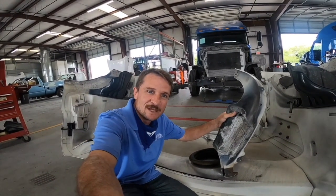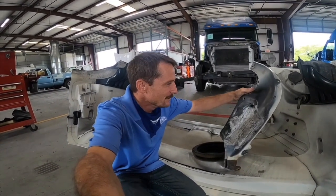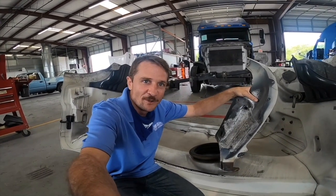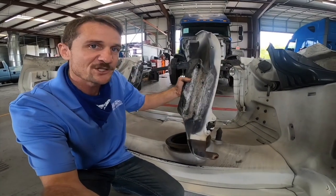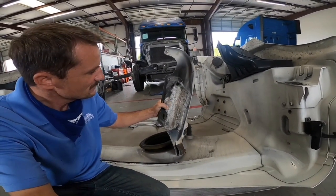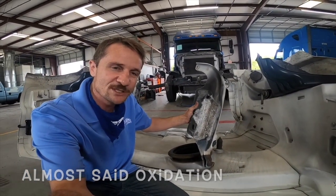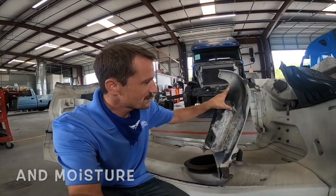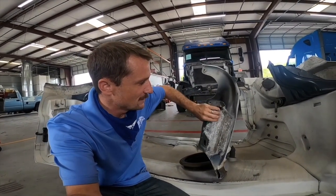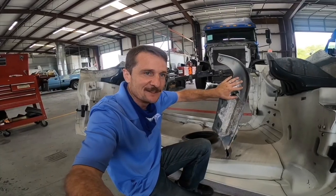Here's the hood we just pulled off this Cascadia — it's a 2012 model. It did have a complete hood bracket separation, as you can hopefully see in this video. That white stuff you see there is called atmospheric corrosion. That's what you get when oxygen works its way underneath the panel and meets up with raw aluminum, and it forms that milky powder.